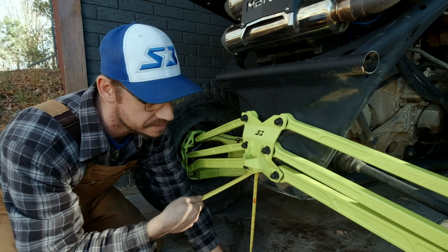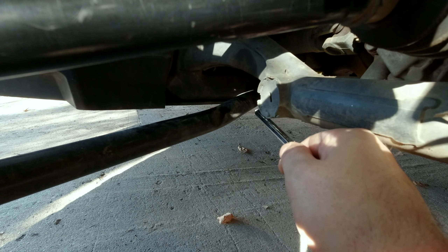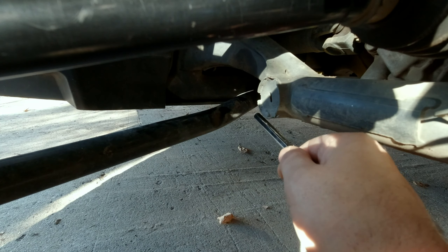For the front ride height measurement, there's a round tube that runs from side to side under the car. I'll measure from the bottom of this tube to the ground, but note that this tube is about one inch higher than the bottom of the car where you'd normally measure ride height — so subtract one inch from your measurement. If it measures 16 inches, subtract one and your measurement is actually 15 inches. The Fox Race Tune instructions have you measuring on the side of the body, but because it's so rounded you could be off by up to a half inch, so the round tube minus one inch is the best way to go.